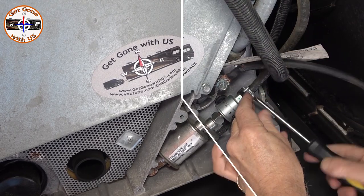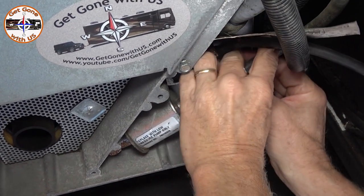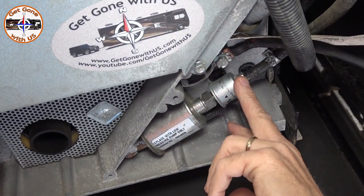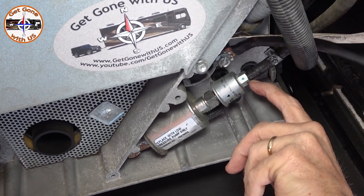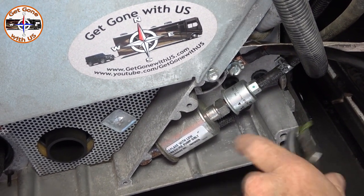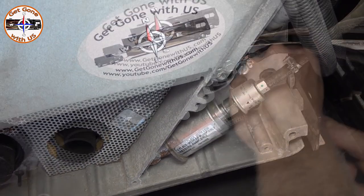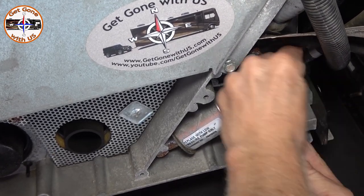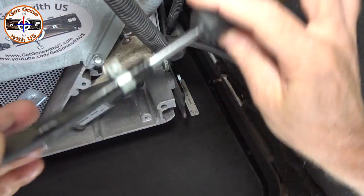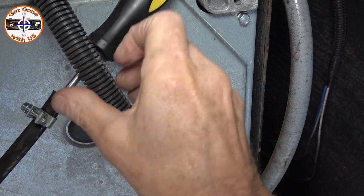I'm just going to unscrew it. This one is actually loose, which is a good thing. If yours is tight, you can try putting a flathead screwdriver up against it and pry back a little. Another way — but you have to be extremely careful — is to take a pair of pliers, grab hold lightly, and just wiggle it back and forth. Do not do it too hard because you can cut the fuel line. When you pull it out there's going to be fuel, so have a bucket handy. Once you get the fuel line off, plug it up — my screwdriver happens to be the perfect size — and put it up out of the way. Now we're going to start it until it runs out of gas.